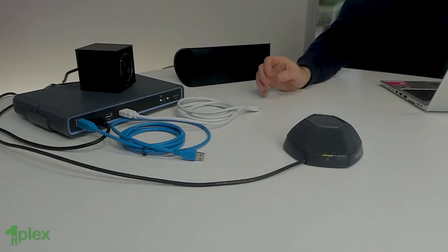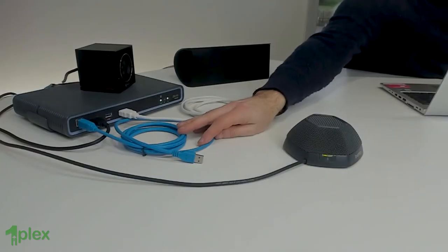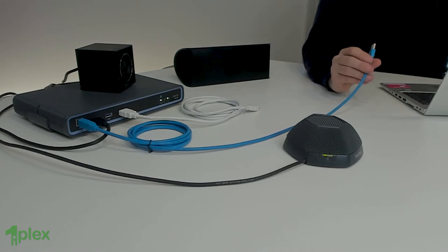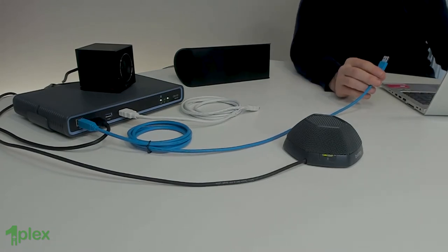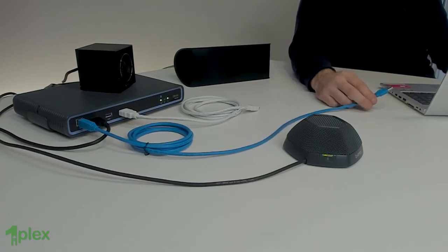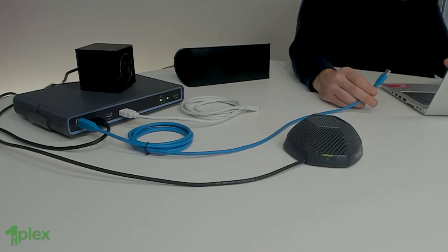That's the device itself. Now in terms of using it, I've got a couple of cables on the table here. I've got this blue cable — this is USB 3. The way the Devio works is it supports DisplayLink. If I connect this single cable to my laptop, I'll get my video over DisplayLink. The great thing about DisplayLink is it's built in — it's standard in Windows 10. If you've got an older operating system it can be installed as a separate package, and it's also supported on Macs.